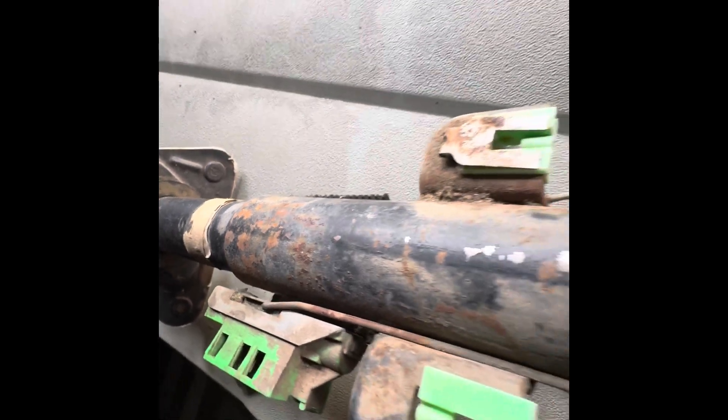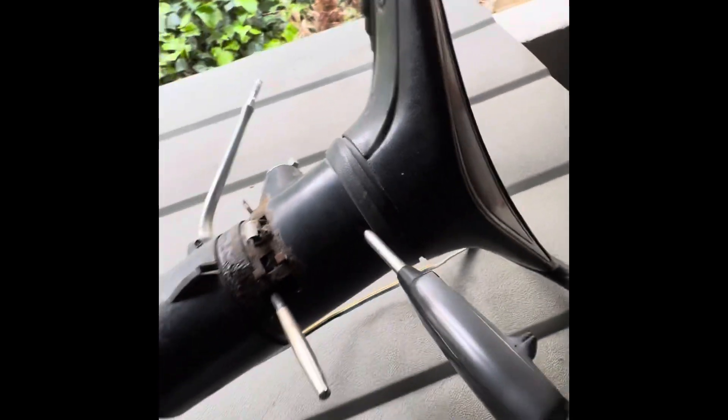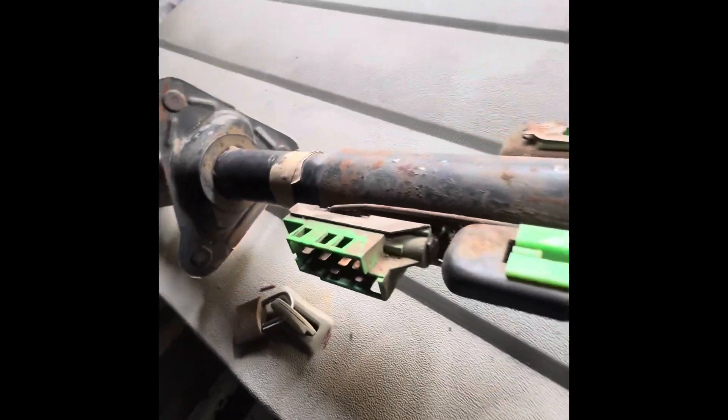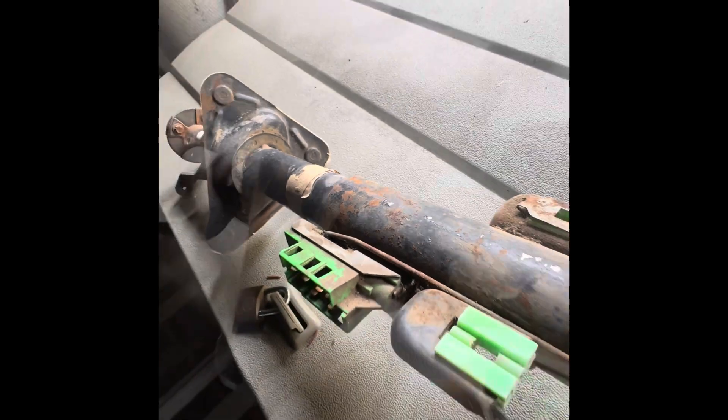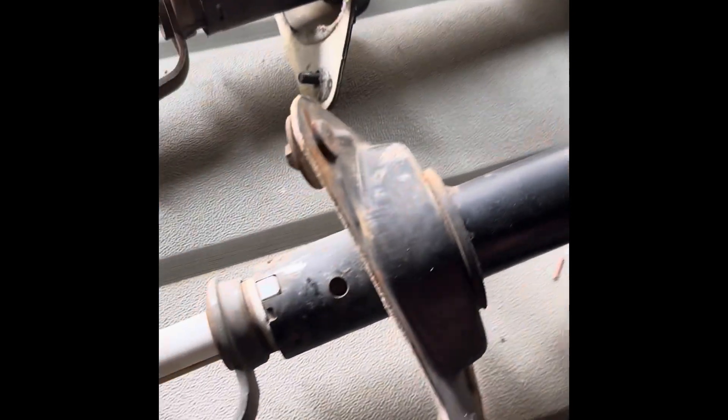This is going to be good. What I'm going to do is clean all this up, give it a coat of paint, check all the connections to the electrical, and get it bolted in. Actually, I'll put my new ignition switch on while I have it all off here. Looks like everything matches up — got the tilt and everything, looks like it's in the same spot. That wire was cut into the ignition. Got to put the new switch on. I'm going to clean all this up, paint it, make sure the bushings and bearings are good, and just go from there.